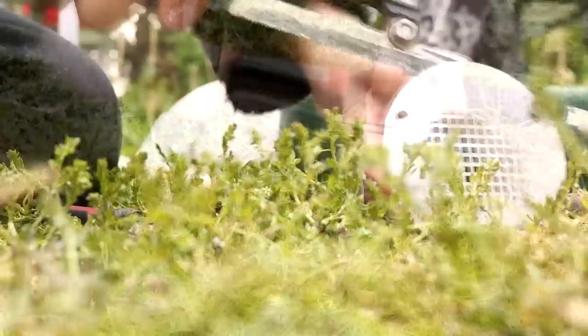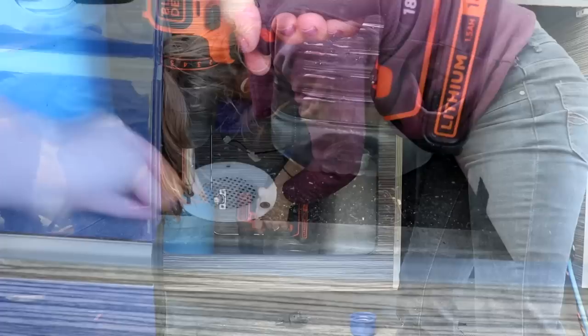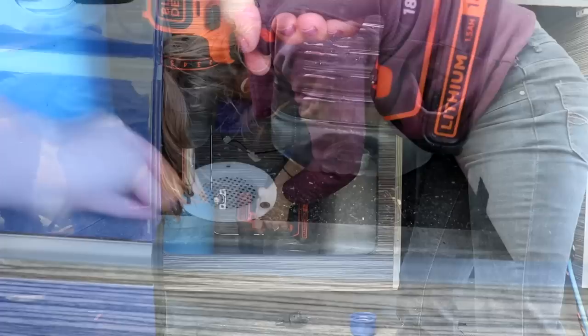My father-in-law insisted we need a vent on the floor near where we keep the gas. So he asked me to cut the grid off at the top and then we tried to put a hole straight into the van. Because we didn't really have the right tools for the job, we just had to be a bit more inventive. I took the easy job of just drilling loads of holes at the bottom and screwing that flat vent piece directly on top. That way, apparently because gas is heavier, the gas should just seep through — correct me if I'm wrong.